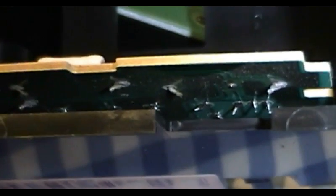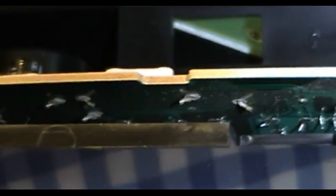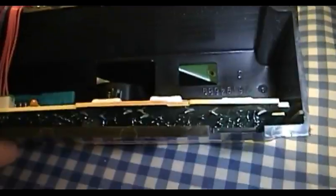It's no wonder the display in this thing was unreliable. What's even more of a wonder is the fact that it worked at all. And those solder joints kind of have an unhealthy gray pasty color to them, so they probably weren't very well done from the factory.